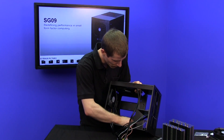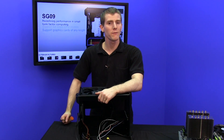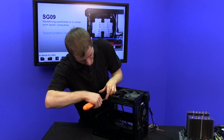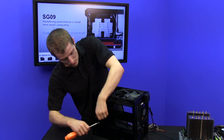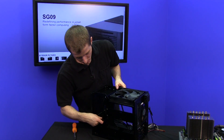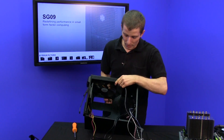Finally we can screw down the motherboard. Before we'll have room to install the motherboard, we need to remove the power supply cage from the case itself, because the very large heatsink we have installed will prevent it from going in until we've taken that out. You can see it's on little sliders. Once we remove that, it gives us a lot more room to work with to put in the motherboard.